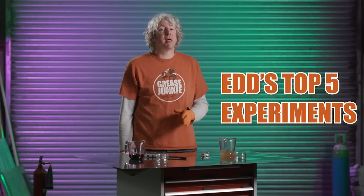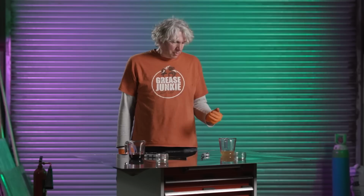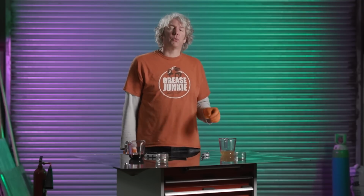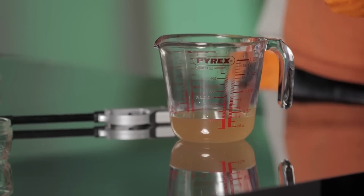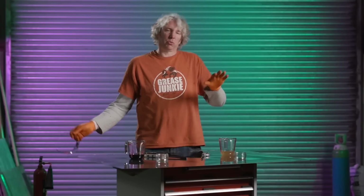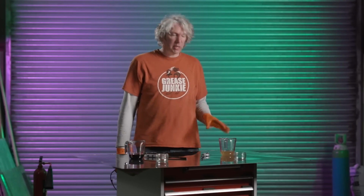I've been swapping out stale fuel for good stuff on classic cars for many years, but I've never stopped long enough to do an experiment just to see how impotent stale fuel is when you compare it to fresh-ish fuel. Now, when you think about this, it's got a flash point of about minus 43 degrees Celsius. And what that means is that's the lowest temperature where this liquid can make enough vapours that could ignite. So because we're at sort of room temperature-ish, or cold room temperature, maybe 15 degrees, there should be plenty of vapours coming off our gasoline.